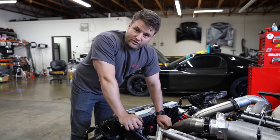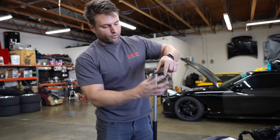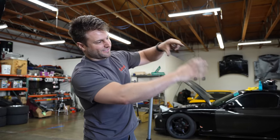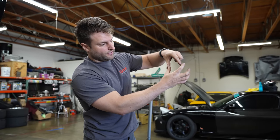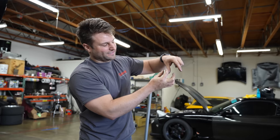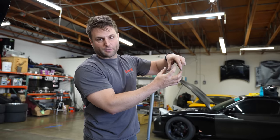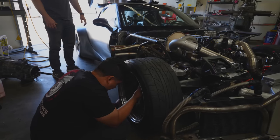Moving better. We gained two things there. One is the brake pad is now covering more of the rotor. So if the rotor is this crescent moon shape here, the pad was just sitting outward about 50 thousandths, as you saw. And so we just shifted it inward. So we're gaining, it's a shorter radius, so it's not as much braking power, but we're doing it properly. And it allows us to fit way more tires onto the car.